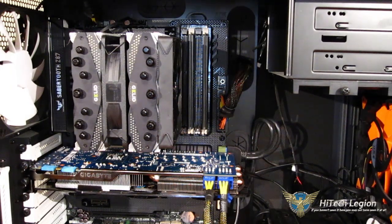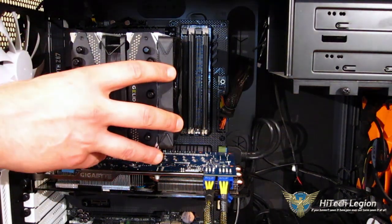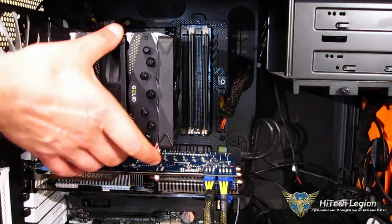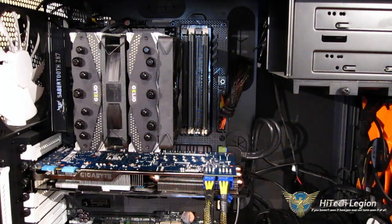After having the Gelid Black Edition on the bench, we definitely have a mixed bag of results. Bear in mind, this is a $75 cooler, so we assess it as such. Performance was solid — no question about that, especially at stock speeds. When you start throwing voltage at it, it started underperforming a bit compared to other coolers in this price class. It's really not going to keep up as an enthusiast overclocking type of cooler. However, it was the quietest of the coolers in the test, so there is a trade-off between silence and cooling capability.